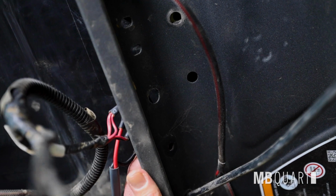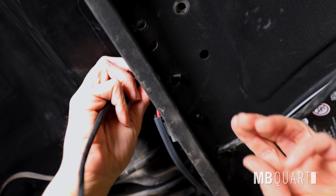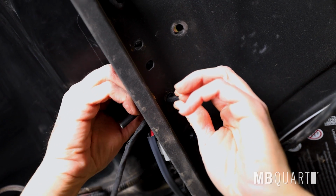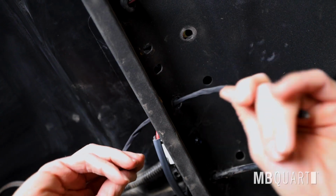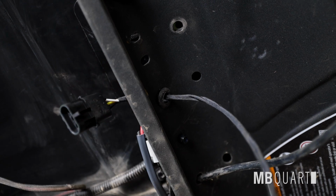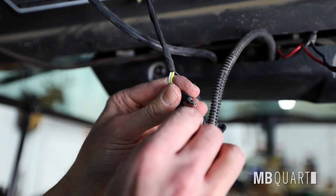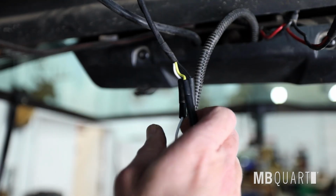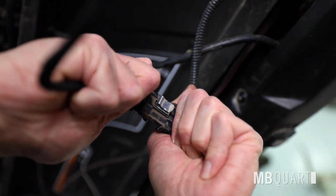Attach the bus bar to the top of the roll cage visor, as shown with M6 by 14mm bolt and M6 nylock nut. Pass the new windshield washer hose through the visor roll cage and connect the black side of the check valve. Pass windshield washer power extension harness through roll cage and connect bullet connectors. Connect the 3-pin weather pack connectors together.